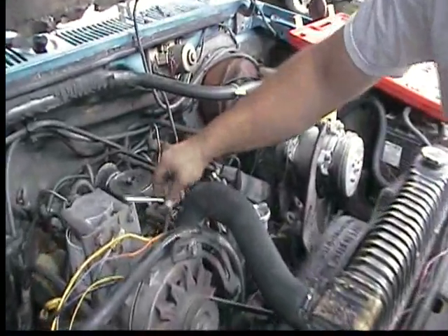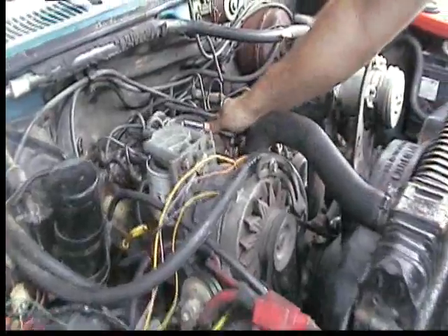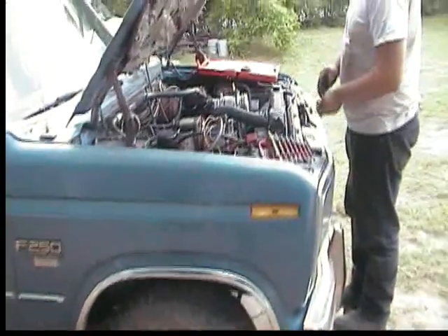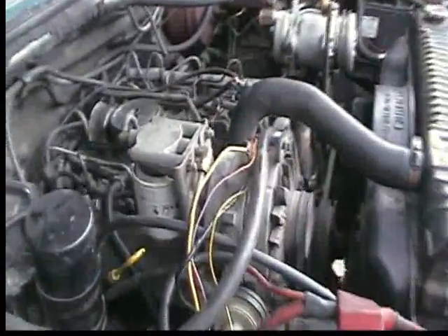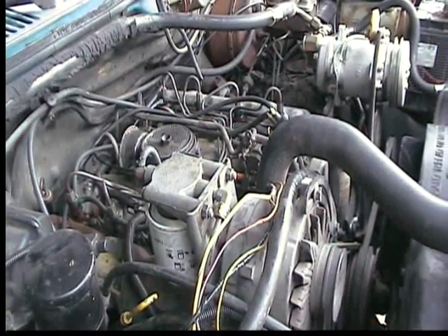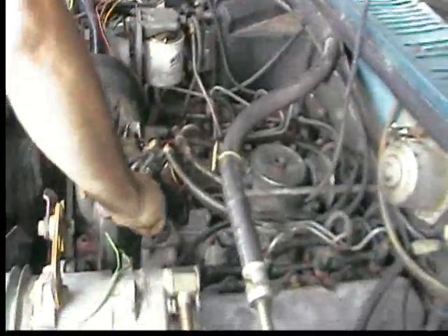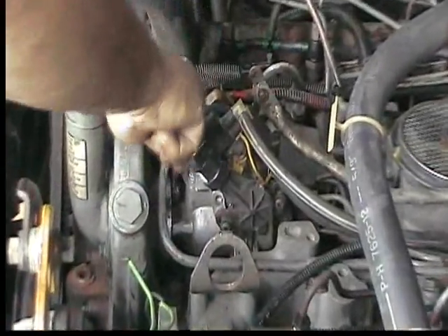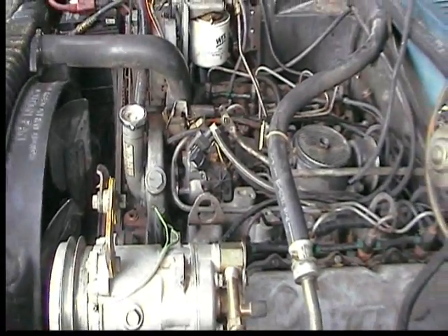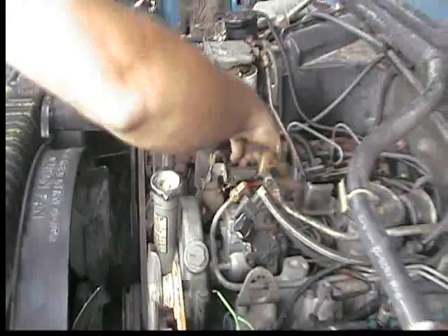We're working on a Ford 6.9 here. We just checked the compression on one of the cylinders towards the front on the passenger side — seems to be okay. This is the same Ford 6.9 I've owned for a while and sold to my buddy. We just got done putting head gaskets on it not too long ago, and that was the culprit for that one dead cylinder. Engine runs good. We still have a fuel problem of some kind because it still has a miss to it, so we're thinking it might be the injection pump starting to cause some problems. We might need to go ahead and get a new rebuild on the pump. We're going to do some troubleshooting here and see what happens.